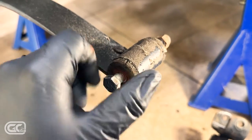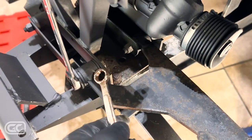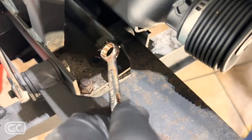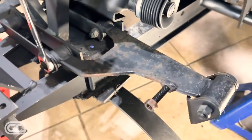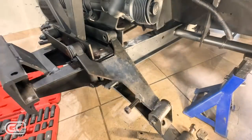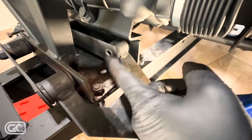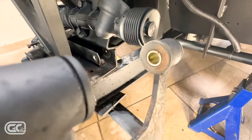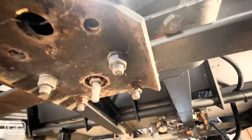For the A-arm bolts it's 9/16 on each one — there's the whole shot, 9/16, 9/16. Get them both off and repeat on the other side to get these old existing A-arms out of here. You're not reusing these anymore, but keep this stuff — you never know when you'll need it. Pull that A-arm out — look at that old retired A-arm. Twenty-two years of service, thank you.